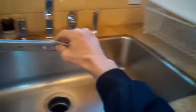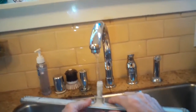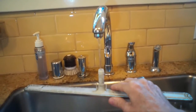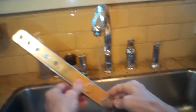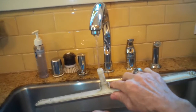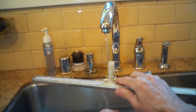There are three arms on the Miele dishwasher — this bottom one, one in the middle, and one on the top. If you get them all clean, there's a good chance your dishes are going to come out a lot cleaner because they'll be able to spray with high pressure water on more of your dishes and utensils. But if these are all blocked up, your dishwasher won't clean very well regardless of what soap you use or which cycle you run.